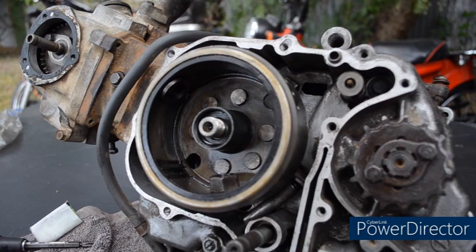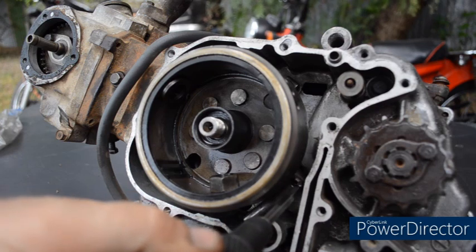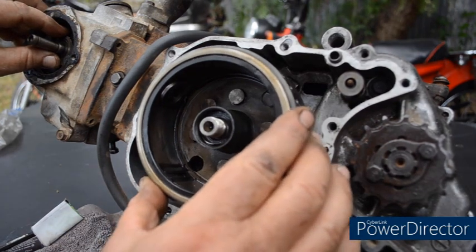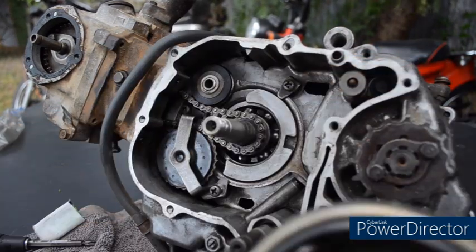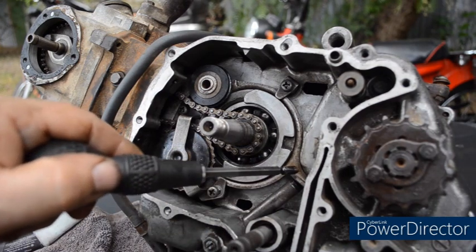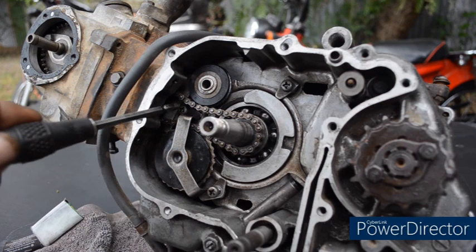One of the reasons why we're changing this timing chain is it's excessively worn. You can see the plunger is on its full stroke — the cam chain adjuster is touching on the casing with no adjustment left. And if we hold the chain, you can see just how much slack there is. Not only will it rattle and spray metal filings throughout your engine, it will retard the valve timing and make your engine feel down on power, sluggish and woolly. With the flywheel removed, we can see most of the timing chain, and the plunger is fully out, touching the casing. The chain is still slack — this chain is worn out.